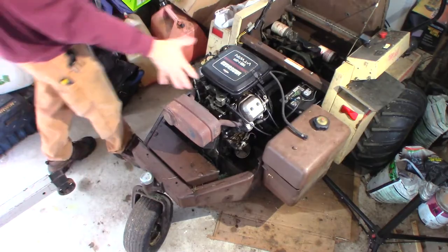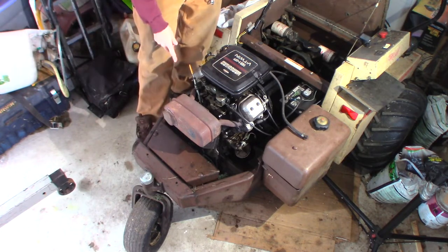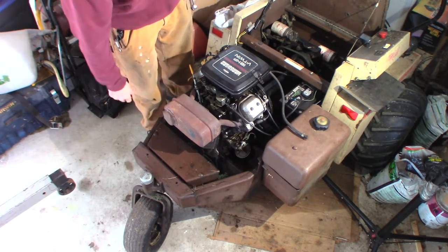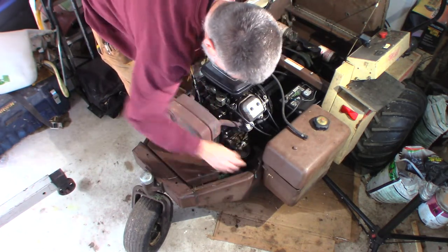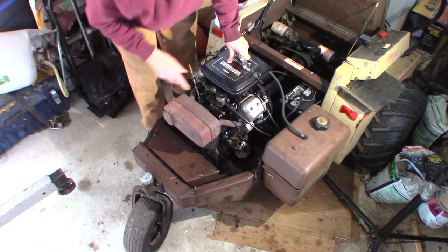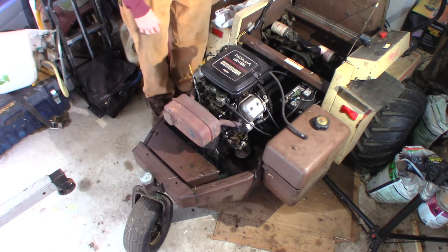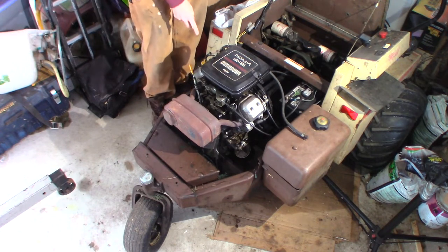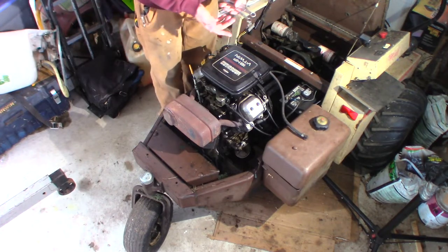For now, we're just going to pull this one out, put a replacement in, and see how that works. We're going to take some things off here — disconnect the battery, there's a ground on this side that's got to come off the block, oil sender, low pressure oil sender unit, unplug that. Then deal with the belts and the drive. On this side there's a couple wires — one to the coil, one to the carburetor. Pull them off and just unbolt the base of it. We should be able to pull it out, hopefully it doesn't take that long.